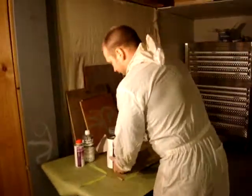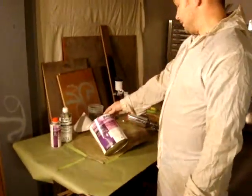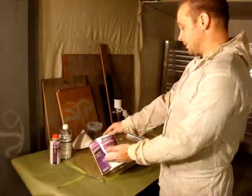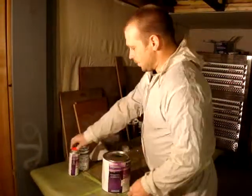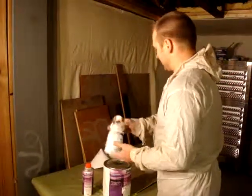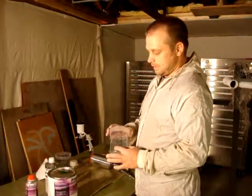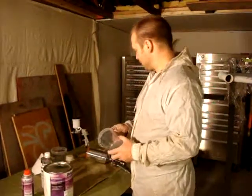We were able to find a color we liked in the bin at Thompson APB Finish Master. It's a bright green metallic. This is an enamel — usually I spray urethane, but we were able to get a gallon of this for $25. It requires a hardener and an optional reduction of about 10%. The paint gets mixed in these convenient little cups with graduated markings for whatever ratio — 8 to 1 to 1, or whatever you're putting in.